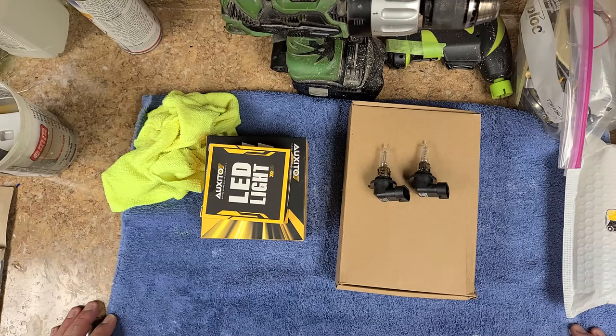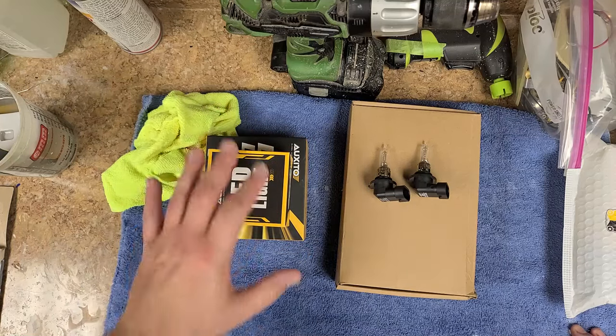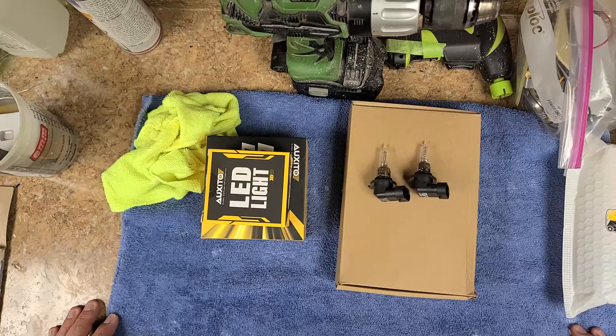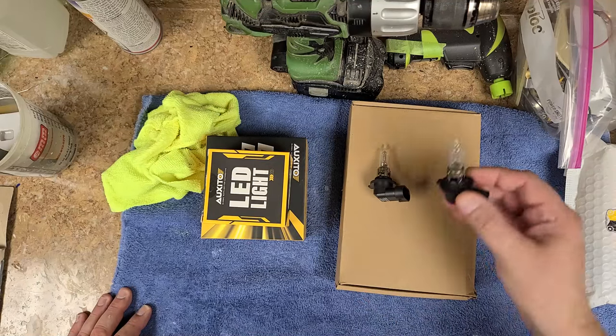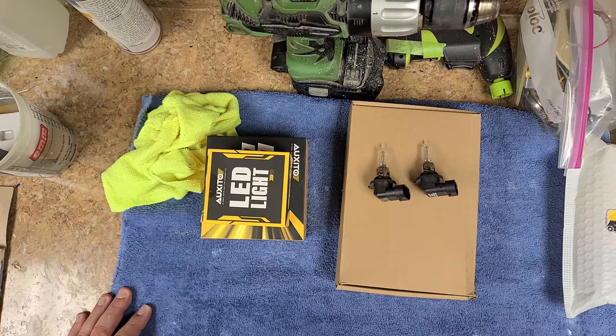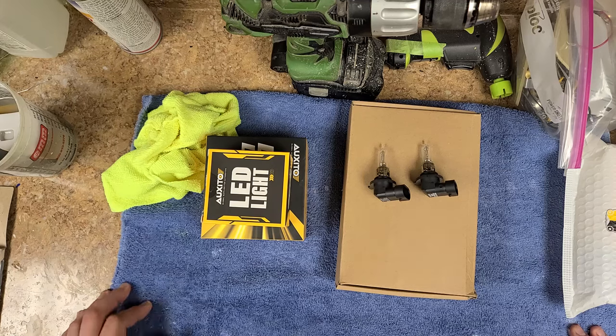I got a hold of some sellers, and one of them told me these LEDs would work with projection lenses with no problem — no dark spots. But they just want to sell their product. The problem is you do get dark spots, which is a shadowing in the light on the road where you can't see. If you don't have the right LED or HID bulbs for the type of headlight assembly with a projector, you're going to have problems.